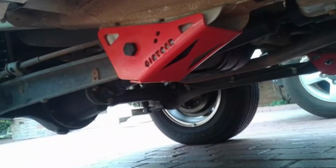These connection points are very exposed underneath the Jimny. That's why we want to put a protection cup over them, so that if you hit them with a rock, you just slide over. If you don't have them installed, you're going to bend those points. That bending and scratches can cause rust underneath your car that can void your warranty, and of course it makes it very difficult to replace your caster correction bushes or just your normal caster bushes underneath. So have those fitted.